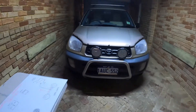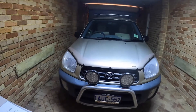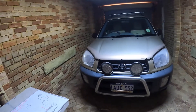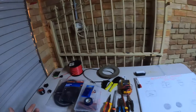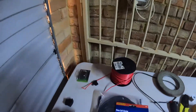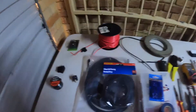Obviously if you've got bigger spotties, like on the Hilux I've got the big 9-inch HTX Light Forces — there I jump up to a 30-amp, just because of the HIDs and LEDs that I've got coming on together. They pull a little bit more, and really if you can go bigger and you can fit it, do it. But using a relay also minimizes how much of the bigger cable you use, but we'll get into that a little bit later.